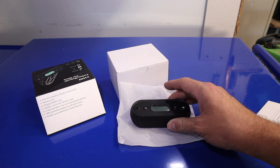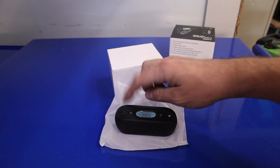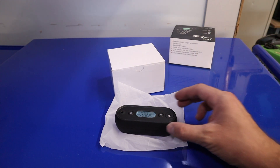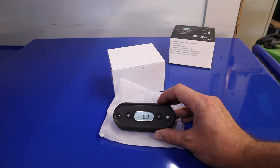We're going to get this turned on real quick and see it in action. You heard the alarm and the buzz — that's the vibrate. The alarm levels are: zero to 50 gives no alarms, that's a fairly normal amount of carbon monoxide. From 50 to 200 you'll start seeing the red light and a buzzer sound. Anything above 200 and this thing starts to freak out.